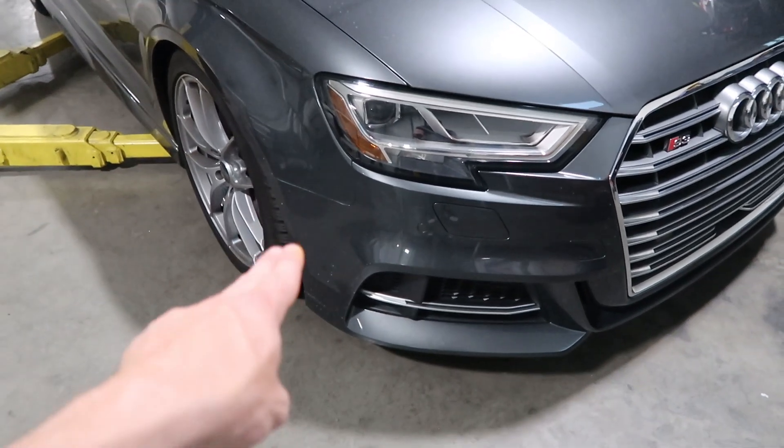The toughest bolt was on both sides right under the headlight — had to undo like half the fender liner bolts to get my hand in there with an extension. Now the front bumper is off. I have the windshield fluid lines here so I'm not sure what I'm going to do with those yet — might leave them connected and try to work around it.